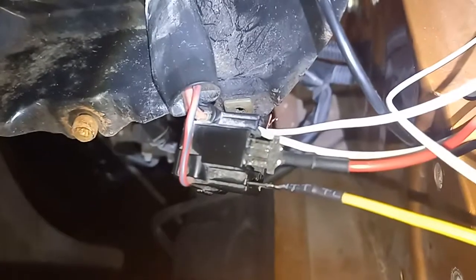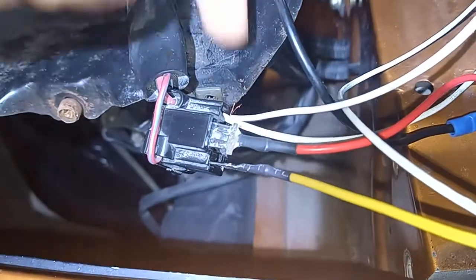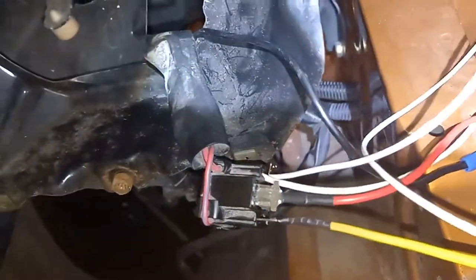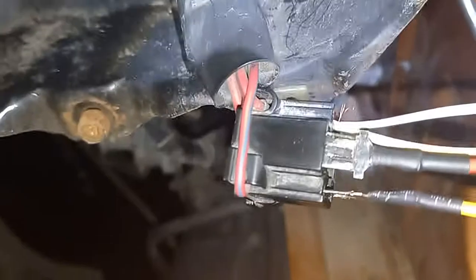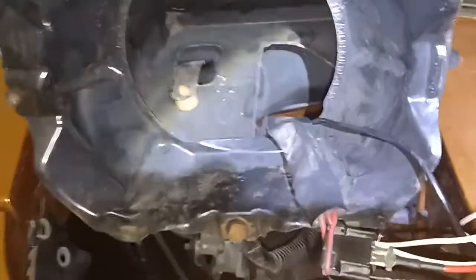Natural question is, well, if all the power here is off, does that mean all three switches are triggered? Well, that may be the case, but if the power source on your negative switching harness is off, then naturally, what's going to power the relay? Nothing. What's going to power the headlight? Nothing. So then nothing's going to be powered, and it'll be off like it's meant to be. As soon as you flick the power and you select low beam or high beam on your switching circuit in the dash, suddenly, depending on which negative switch you've chosen, it'll feed into the relay, and suddenly the relay will click and it'll power the headlight and it'll go to your customized earth that you've chosen. Okay, and I'll show you that proof of concept now.